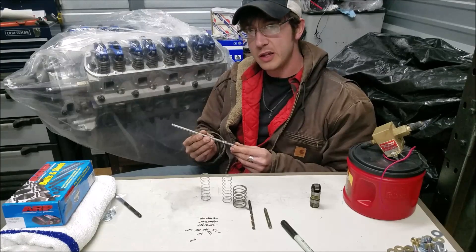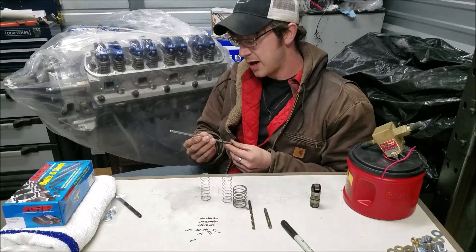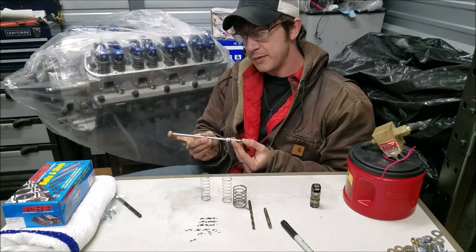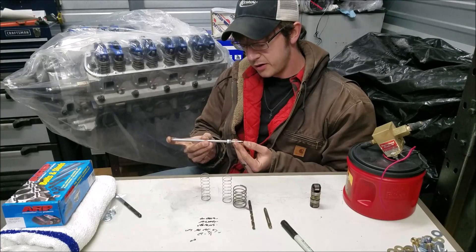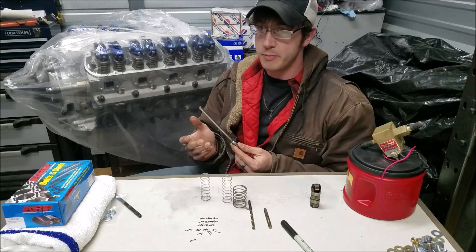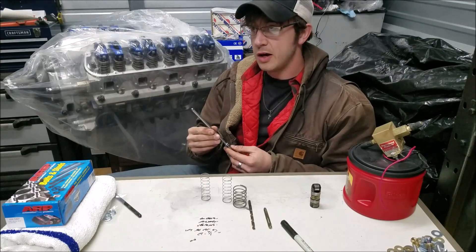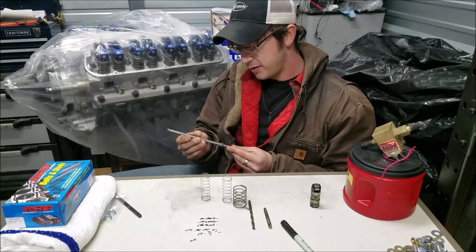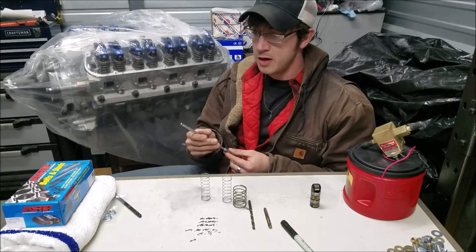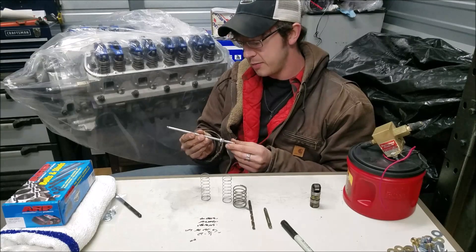There are some challenges with making your own versus buying one. The biggest issue is that you never know exactly which point manufacturers are measuring from end-to-end. This is usually okay because if you're making your own you're probably not buying custom exact-fit push rods — you're probably going through Trick Flow and getting those $100 hardened push rods that go up incrementally every 50 thousandths. They're nice pieces and work well for a street car, but the measurement isn't exactly perfect, and that's what I don't like.